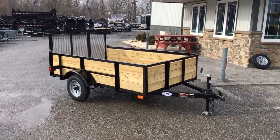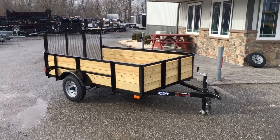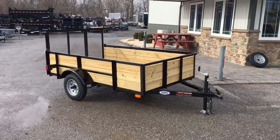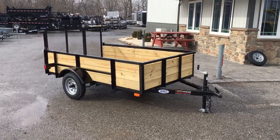As equipped, this unit's a 2,200 pound GVW. It's going to weigh in at about 600 pounds empty, giving you a net legal payload of about 1,600 pounds plus some tongue weight. A trailer like this can be hauled behind most any tow vehicle — minivans, small SUVs, all of the above.